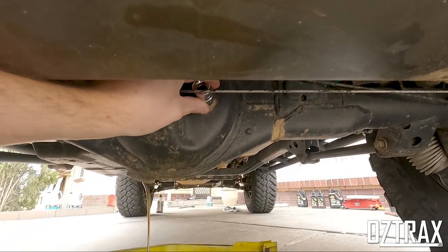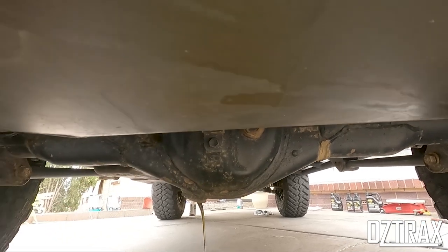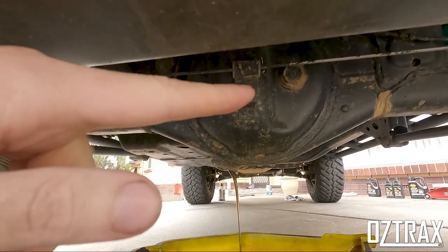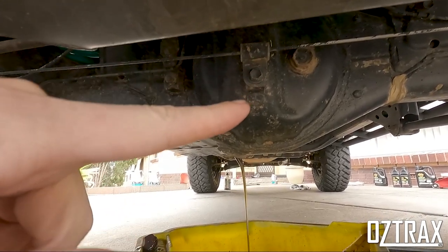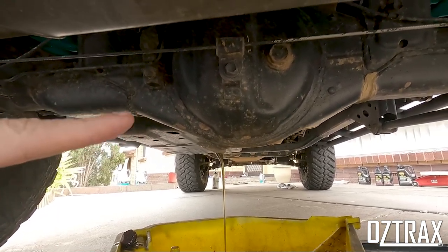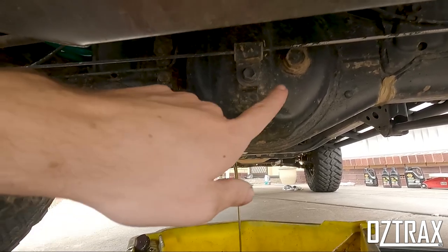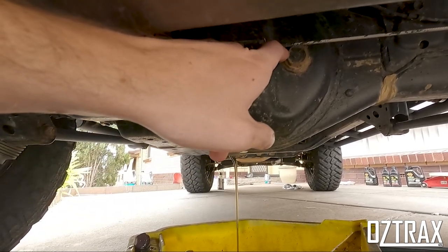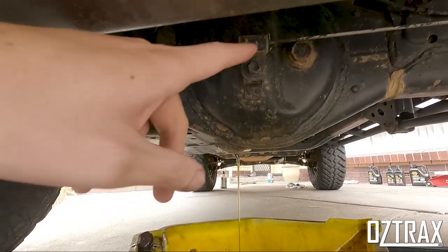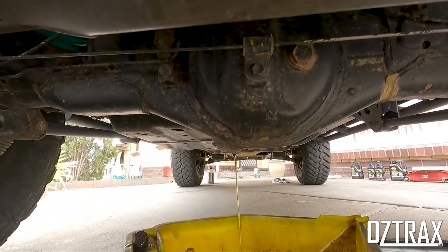I have a feeling that's probably a 24mm too — yeah, it's a 24mm as well. So 24mm socket for the bottom on a breaker bar, and a 24mm spanner up the top there. Now we just need to do what we did with the front one — put the hook in for the Tom Thumb, put the drain plug back in, and pump it up till it starts leaking out. Then put the fill plug back in and you're all good to go.